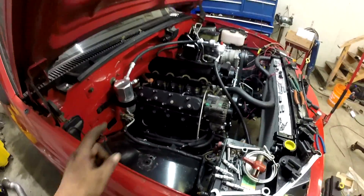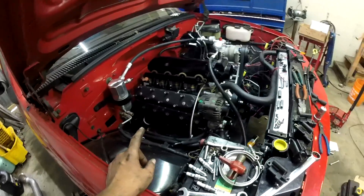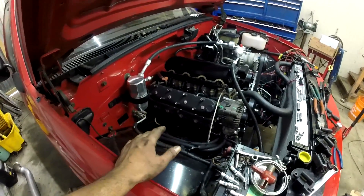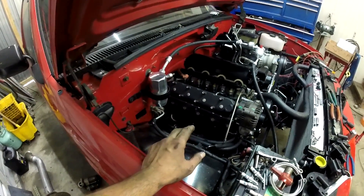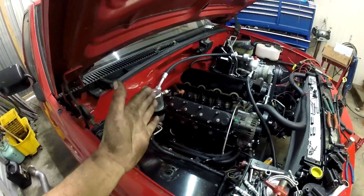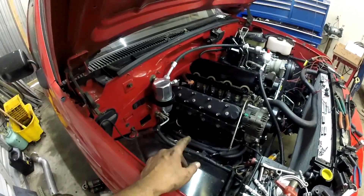Today's project was to get all of the torque converter bolts in. I never live-checked the starter. In order to go from the 4L60 to the 4L80, I had to use a special spacer and a special flex plate. I never checked the clearancing between the starter and the flywheel — the flex plate, the gear. I was unsure of how to put it on, so I just put the torque converter bolts in. You're supposed to have an eighth inch of gap when the torque converter is all the way in the transmission, so when you put the bolts in it'll pull it out that eighth of an inch. I had that, so I didn't really think there was any issue.